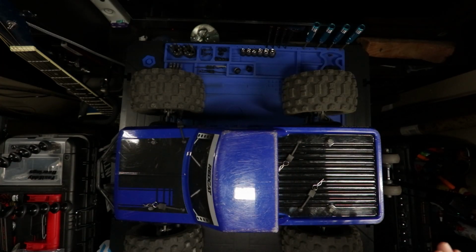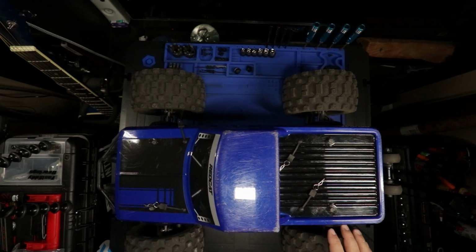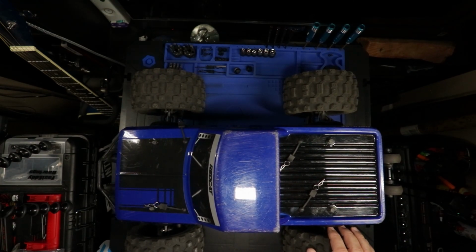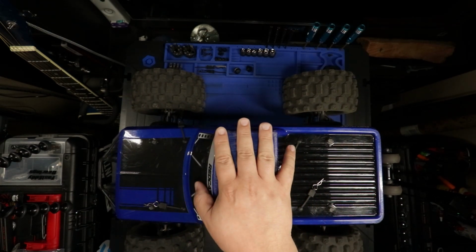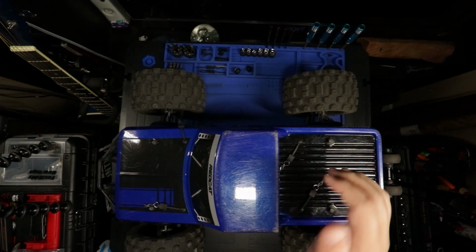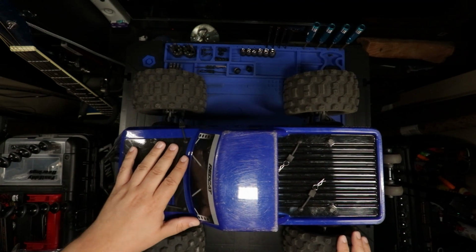I think the biggest glaring issue with every Kaiju, regardless of when you bought it and how hard you bash it and whatnot, is the servo horn. Like I said, mine was damaged from the factory, and the servo that they ship it with is powerful enough to strip the servo horn. So that's the very first thing. This should not have a plastic servo horn. Not just beyond the price point, but also for the level of the components that are built around it and the servo that's in there. I mean, this should really ship with an aluminum horn.